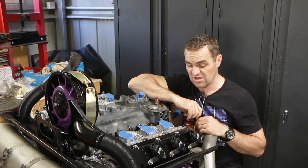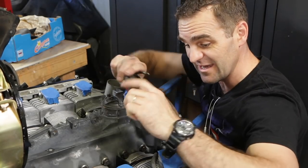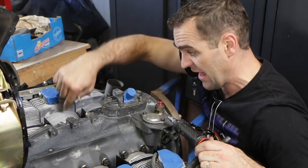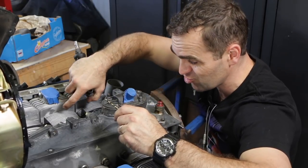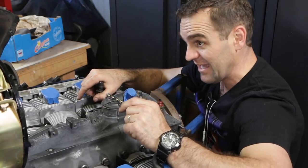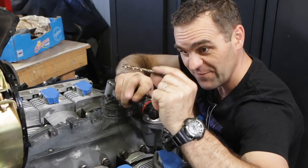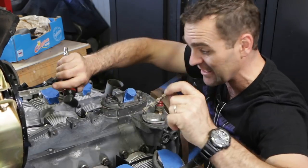I'm not going to go to that extent. I'm just going to drill and tap into the center cylinder head on either side and bolt them straight on there. Joining together would definitely be a better option but for me this is easy access. The current issue is I don't think any drill is small enough to fit in here, but I do have a die grinder — I should be able to fit a 7mm drill bit in that to drill the hole, then tap it out with an 8mm tap. I just have to modify the drill bit first.